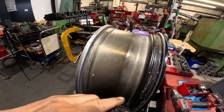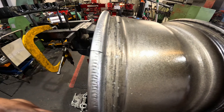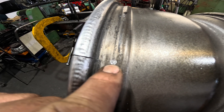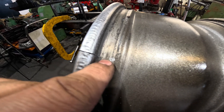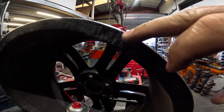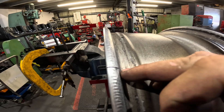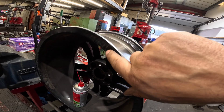The next job I'm doing today is this BMW wheel - it's actually for the Ford main dealer in Newbury, so I don't know why they're doing a BMW, but it's got a dirty great big crack all the way through it. I've drilled a stop hole in it first - I haven't gone all the way through yet - to stop the crack spreading anymore. I'm now going to V this open with the carbide burr and die grinder all the way down and along the back, then fill it with weld at the back, fill it up here, fill all this with weld, neaten this part off but leave this part built up with weld to give it some strength.